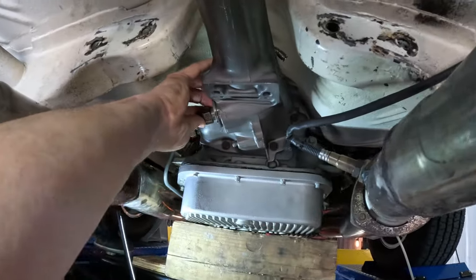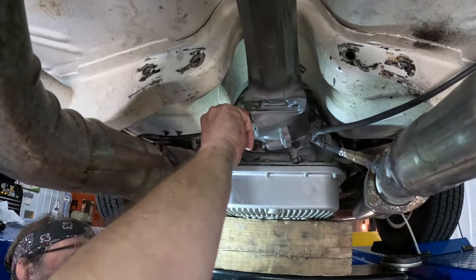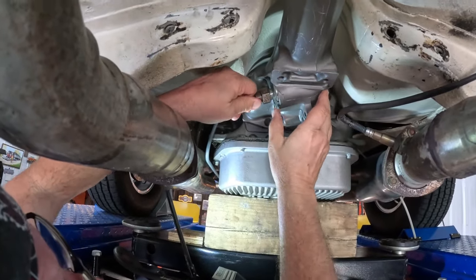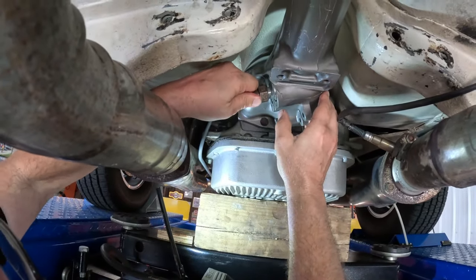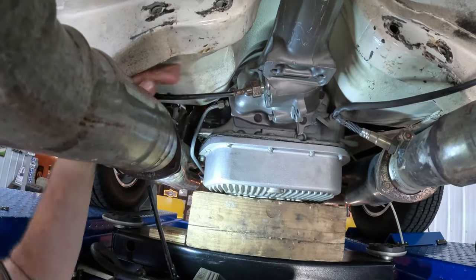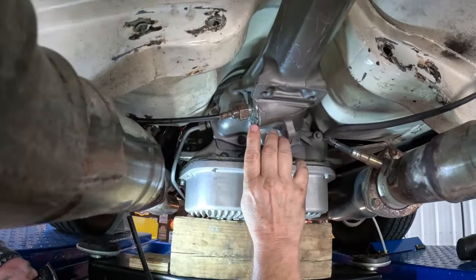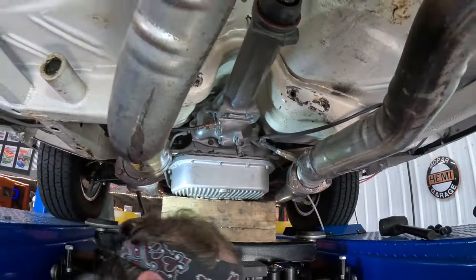You know how many teeth are on there, so now you should be able to look at the numbers on the housing, and right next to the number, the 35 is your number. There's going to be a line on the housing, and a little dot that's cast right into that housing. See, I got our line back up right there. Yep, and that's where your strap goes. 32 to 38. Yep, and that clocks your Speedo.